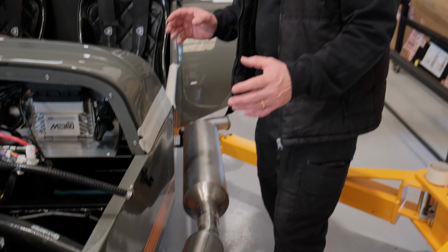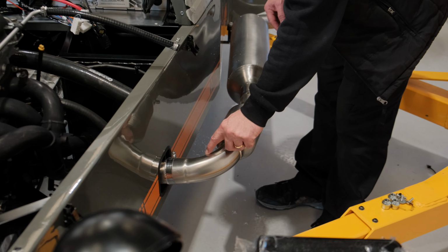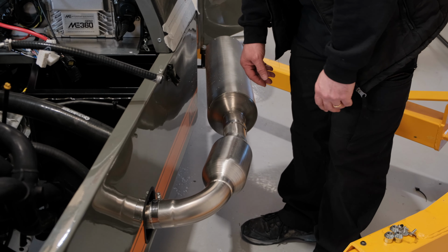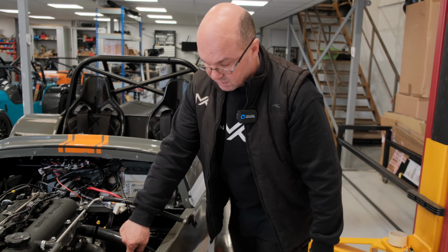So if you've got a VVT engine running stock management, you'll need a Lambda sensor port here, and you have one on the other side because it reads pre-cat and after cat, so it does both on those, so you'll need 2 ports on it. Non-VVT doesn't make any difference, it's already on there.